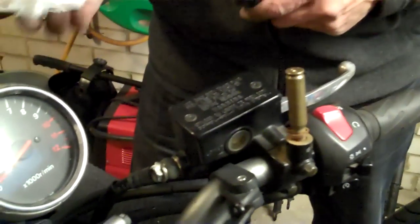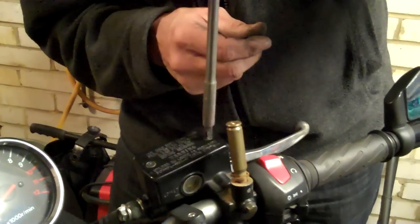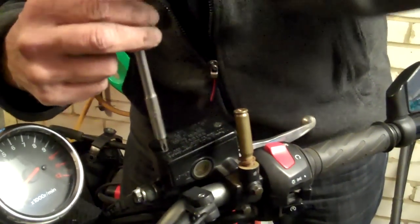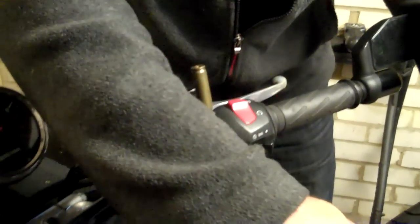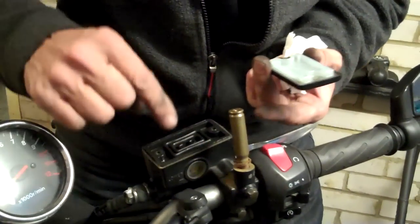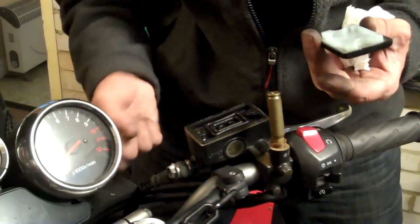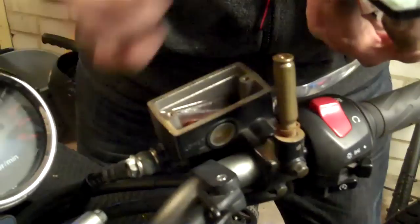This was a specific request from my mate who got the 650 Bandit. Two screws on top of your reservoir — get a decent quality precision screwdriver, not a big fat old horrible rusty thing. Get it in, give it a tap so it's home, and very gently just undo those screws. They shouldn't be tight. If they are tight, don't keep leaning on them until you mince them — just tap the screwdriver in. Once you mince those screws, it's quite hard to get them out afterwards. Inside the cap, we have a plastic board which holds it still, and then we have the rubber diaphragm. The way that squishes up and down — when you release your brakes and pump downwards, that pushes the fluid out. Something needs to suck the fluid back up into the reservoir, and it's this rubber thing. That's why it needs to be not split. And inside there, as you can see, is the fluid.